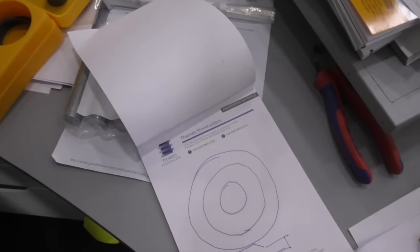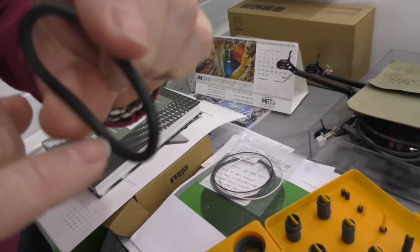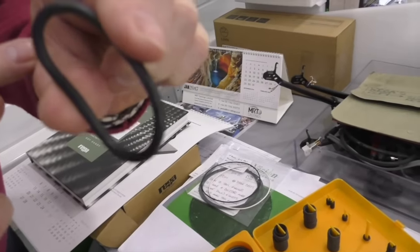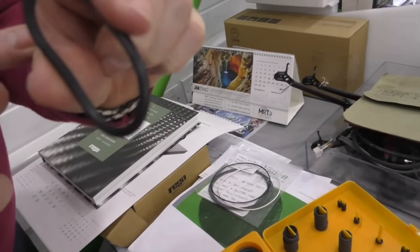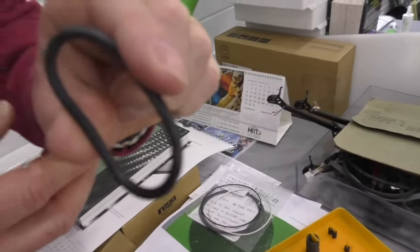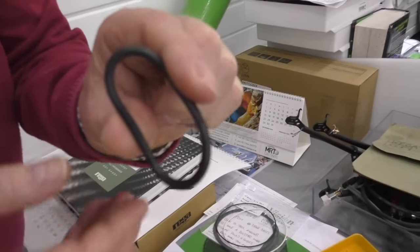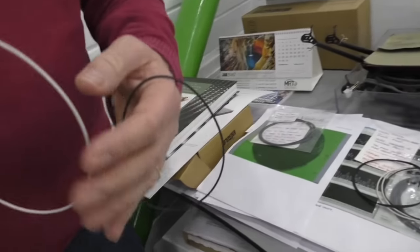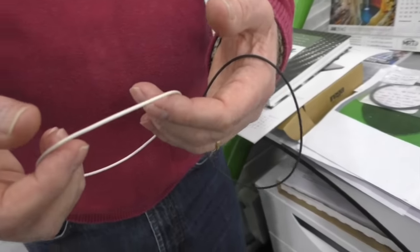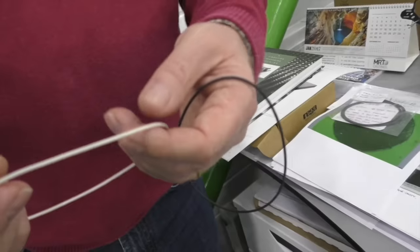This is a standard O-ring out of this kit, and you'll probably see inside this O-ring a split line — a ridge. That split line is part of a mismatch between the two halves. Roy is explaining how with different tooling they avoid that. Of course that split will give you speed issues for a turntable.